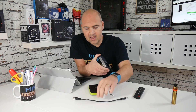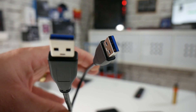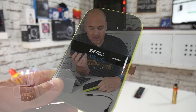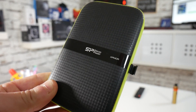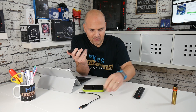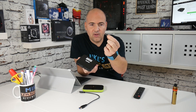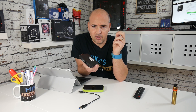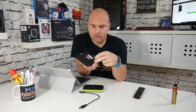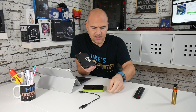The things you will need are a USB A to A cable — make sure it's a data-enabled cable. You'll also need something to press in the reset button; I'm going to use an iPhone reset tool, but a cocktail stick or anything like that should do the job just as well. In some instances you may not actually need this — you may be able to flash the firmware without pressing the button — but depending on your setup and how badly corrupted it is, you may or may not need it, so have one handy just in case.